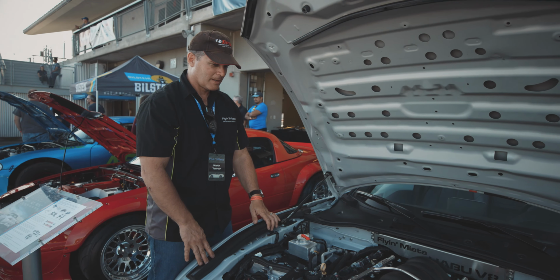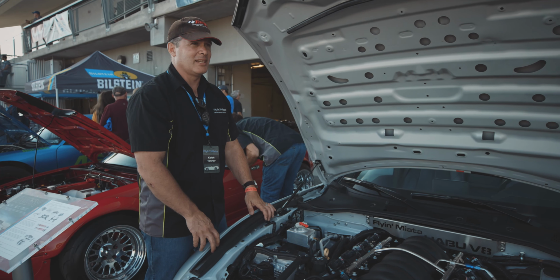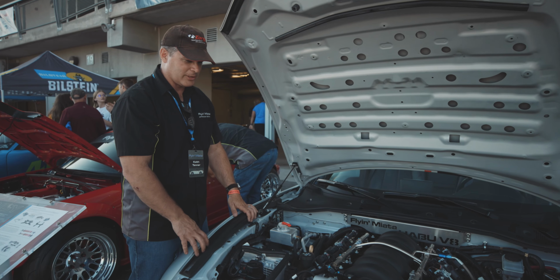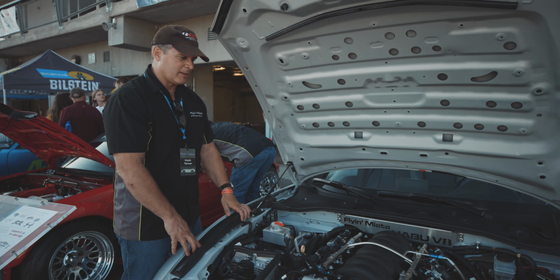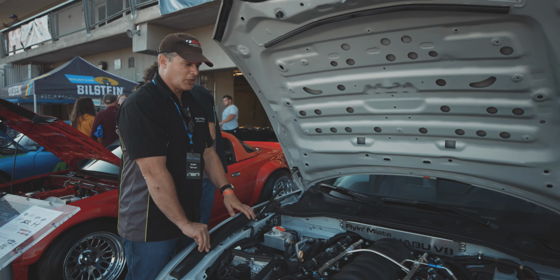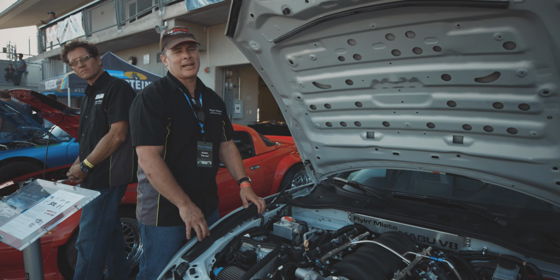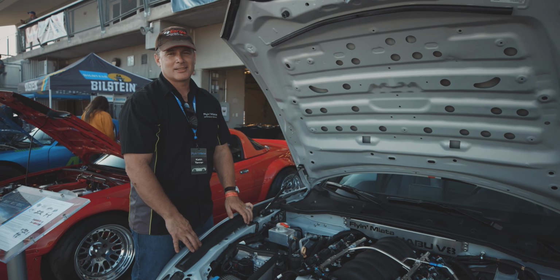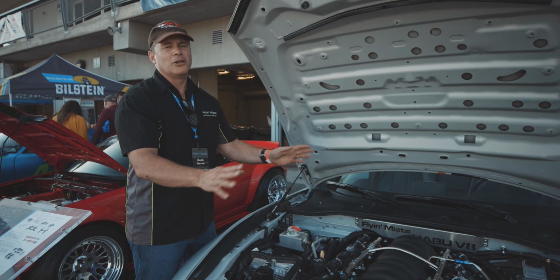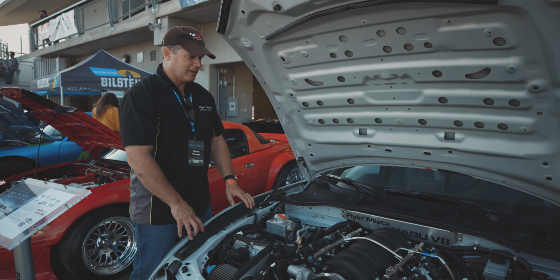What's the miles per gallon on this thing? Actually, on the highway, it did about the same as a turbo Miata. We were in the high 20s when we were driving this thing down to California a few months ago. Around town, it's a little more tragic. These things run on a gallon per hour basis. So you are going to consume so many gallons in an hour, and if you are going slowly during that hour, you will use a lot of gallons. So yeah, it'll do stop and go traffic. It's just atrocious, but that's the case with all LS engines. But get out on the highway, and it's happy as a clam.